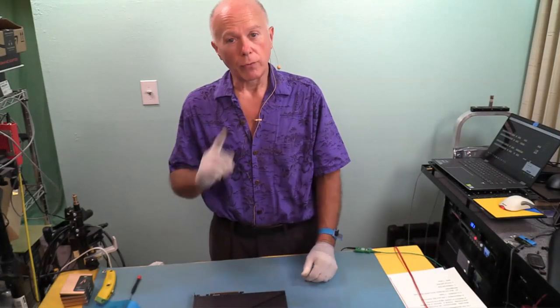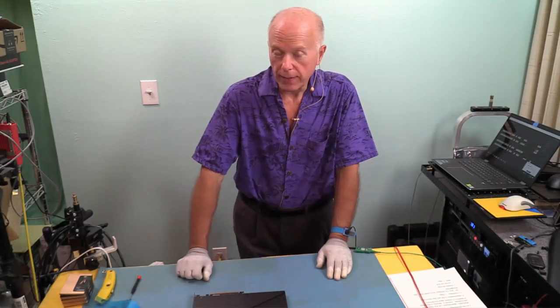Right now, we just want to get this one installed. When you think about it, there's a lot of technology going on here, and we shouldn't take any of this for granted because it's amazing that we can do this, but you got to make sure you meet all the requirements. And I think a lot of people get confused about the specs. It's pretty straightforward. You've got to have one 16-lane slot, and then you have to have bifurcation.